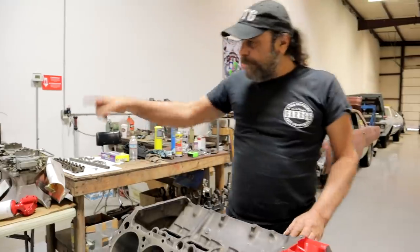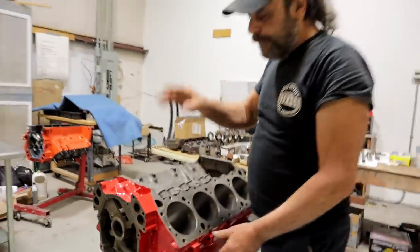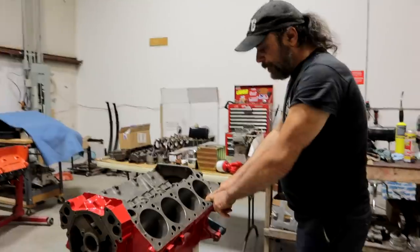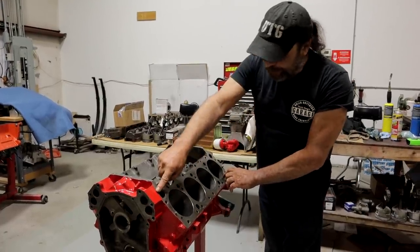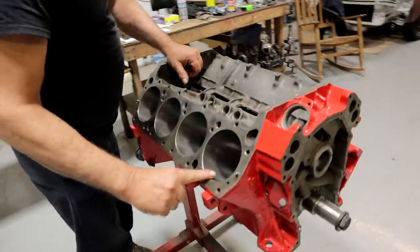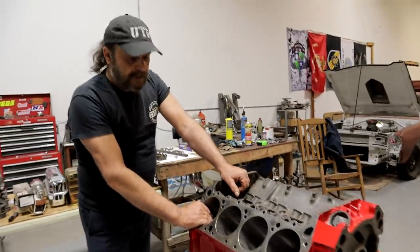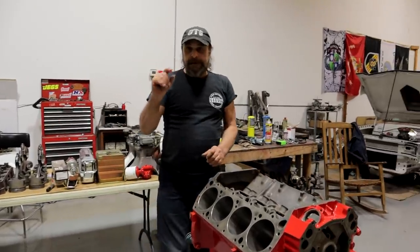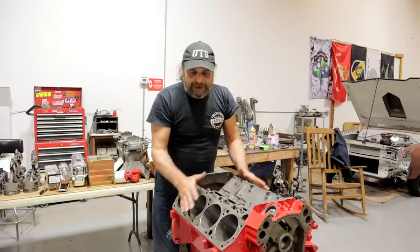We checked all eight of our piston and rod assemblies on one hole — this one hole — and we found that a few of them measured the same, and a few were high and a few were low. Then we took one control piston, put it in here, ran it to top dead center, and found a five thousandths of an inch difference in deck height from front to back on one side, and four thousandths lower at the back on the other side. So we hand selected our pistons so that the differences in piston height make up for the differences in deck height, giving us a much more even engine as far as compression heights go.